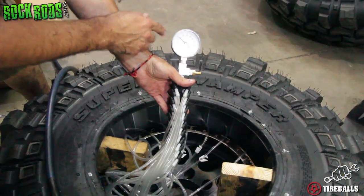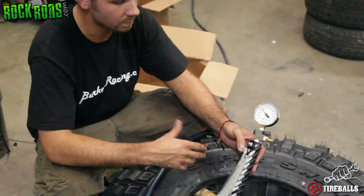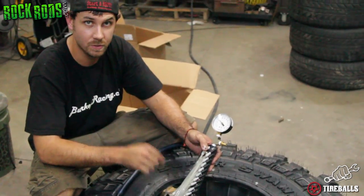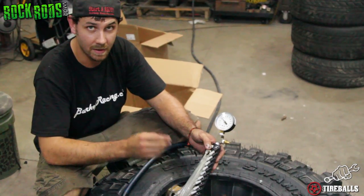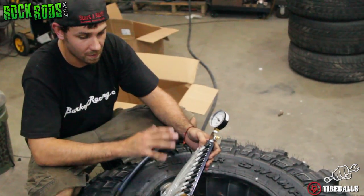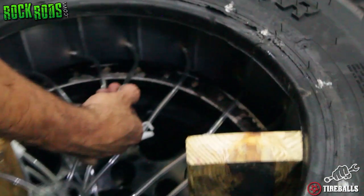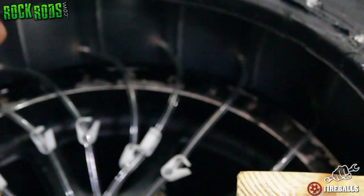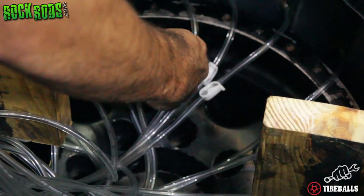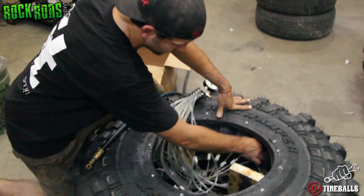We're sitting at 18 psi now. Every tire and wheel combination is going to get a different pressure, and you're going to want to play with these things until you get them perfectly the way you want — enough squish but they don't roll over in corners, and you can still take hits and get a deadening feel. Tire balls are a tunable part of your suspension; adding or subtracting balls and adjusting pressure will give you different rebound. Once pressure is equalized at your target, close the little valves so pressure doesn't leak out when you pull the hose. Clip them down and pull them out one at a time, all the way around, making sure everything slides out nicely and your valves are closed.